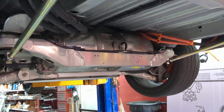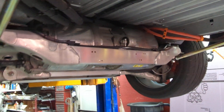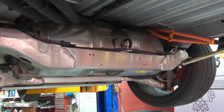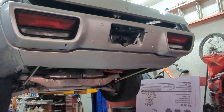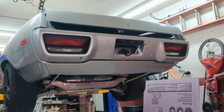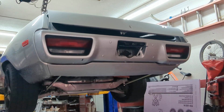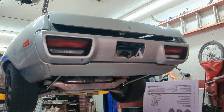That T2C has been working great but I actually damaged it, so the car is not working right now. What happened was I was firing up the T2C using the Holley Smart Wire programmable wire harness. The problem is I'm using one controller to power another controller. I had the T2C powered up when I made a programming change on the Smart Wire, and it does a power cycle — that damaged the voltage regulator in the T2C. So now I've got it wired to just switched battery power, which I should have done in the beginning.